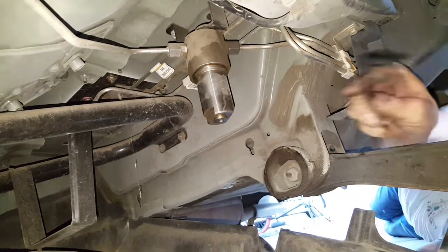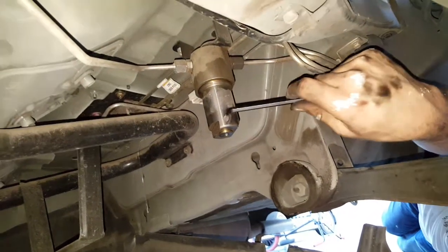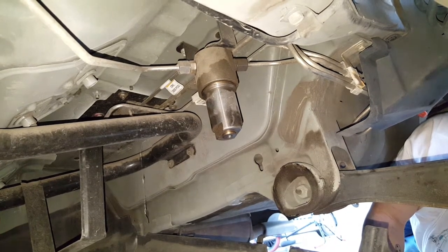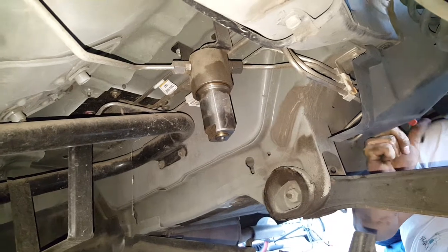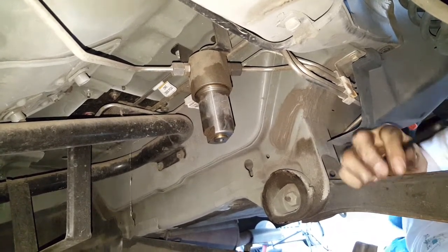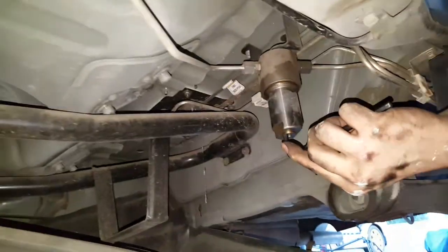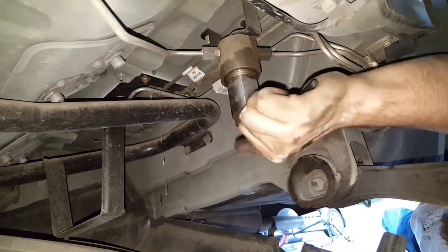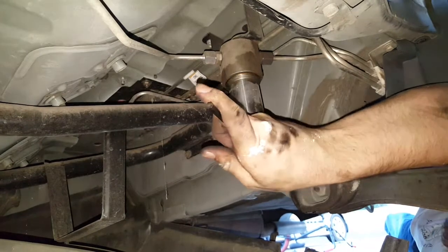This right here is the canister where your fuel filter is located. I did turn off the fuel with this little valve right here, and then what you're going to do is get a size 6 Allen wrench metric and just turn here — this is a way of relieving pressure to the system.